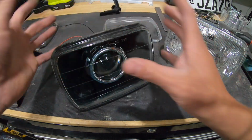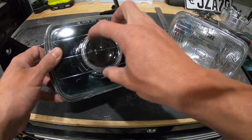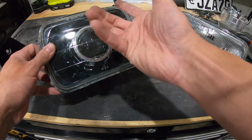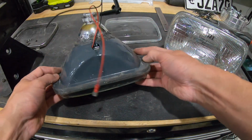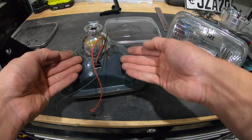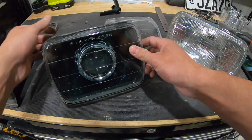But once they're separated, you will have that little projector piece that's inside there. I believe it's screwed in, or it's got little rivets or whatever holding that makeshift projector in there. Just break those out and throw that in the garbage. You don't need that. I'd measure the base of the projector, go in the back side here, and cut out small increments at a time. So cut it down until this piece starts to slide through, and then you're clear up front.